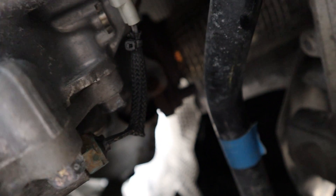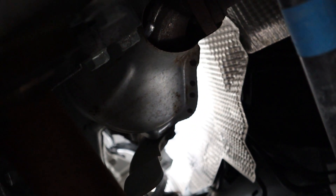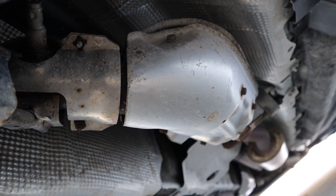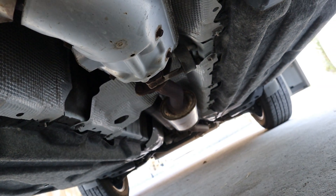From underneath, next to the transfer case, you can see the rest of the catalytic converter coming off the engine, and those gases are sent over to a flex pipe. Flex pipes are not preferable because they crack and break over time and you have to weld on a new one. The exhaust then goes over the subframe to the next catalytic converter, which is nicely accessible — and also easy to chop off if you live in the wrong neighborhood. Then the exhaust flows down to the resonator at the back.